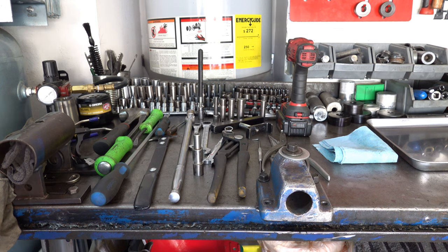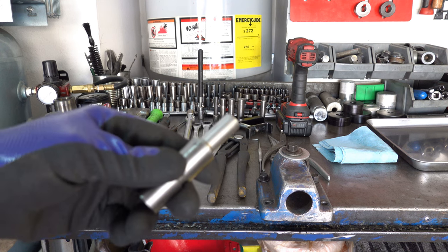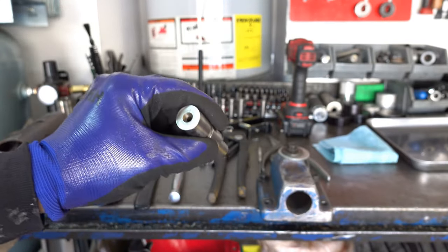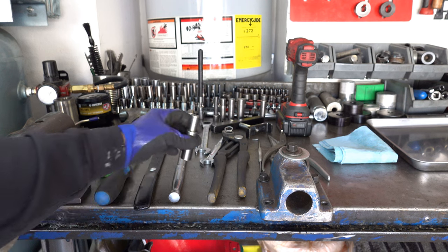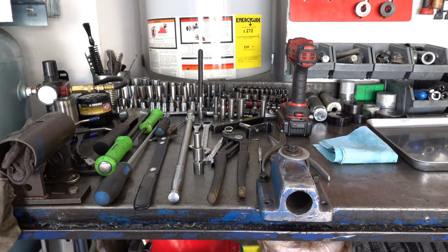The only other specialized tool that I'll touch on is this governor bore checking tool. Every once in a while, a transmission will come in, like a 700R4, where the complaint is erratic shifting, no upshifts, or inconsistent upshifts, downshifts, etc. And when we check the governor, it's fine. The valve moves and there's nothing wrong with the teeth on the gear. The valve body also checks fine. No valves are getting hung up.